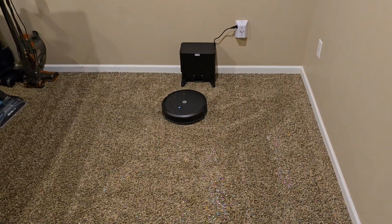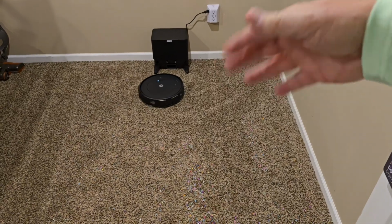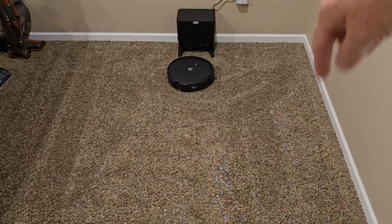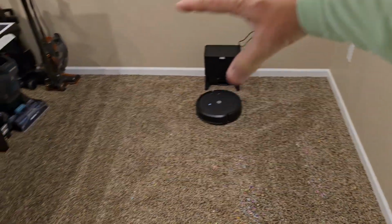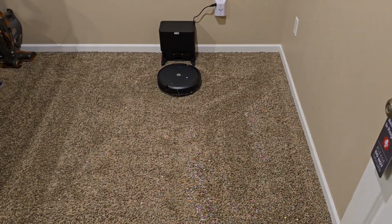And that's so funny, because with LiDAR, you can lift them up, put them upside down, and when you put it back, you can even put it back somewhere else. And the first thing most robots with LiDAR do is they go in a circle. They just spin, and that LiDAR says, okay, where am I? It's locating itself, and it knows the house, and it can say, oh, I was here, but now I'm here. LiDAR navigation is the way.